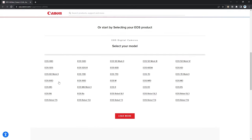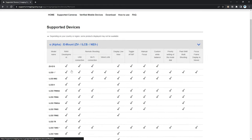Both Sony and Canon have a webpage and documentation that lists compatible cameras and their features in remote shooting. I'll be sure to link those pages in the description — be sure to check whether your camera is compatible with the things I'm about to cover. Both Sony and Canon cameras can connect to your smartphones wirelessly, and you can also connect cameras to your PC via Wi-Fi, either by turning the camera into a hotspot or by connecting your cameras to an existing network. One drawback of using a wireless method is that it drains your battery a bit quicker. I wanted this video to be focused on the wired, tethered method, although a lot of what I cover overlaps with wireless methods.